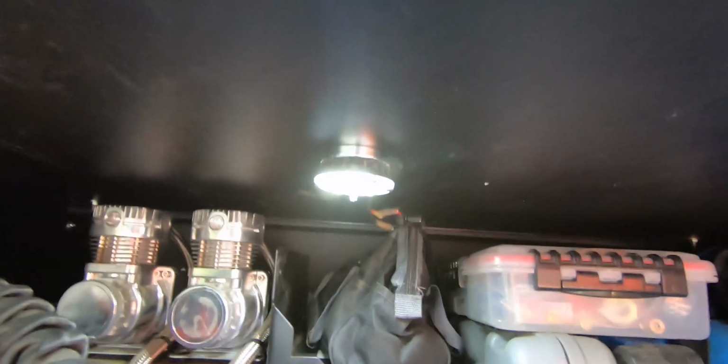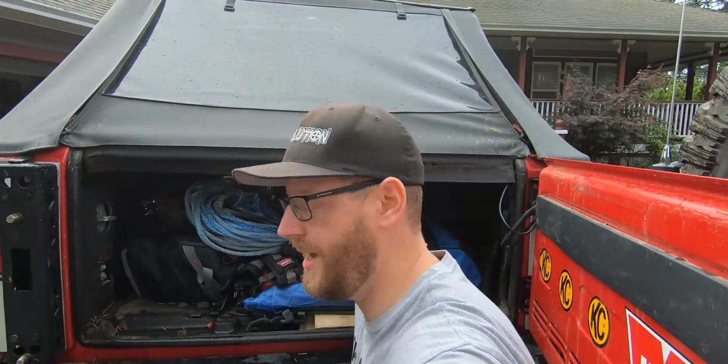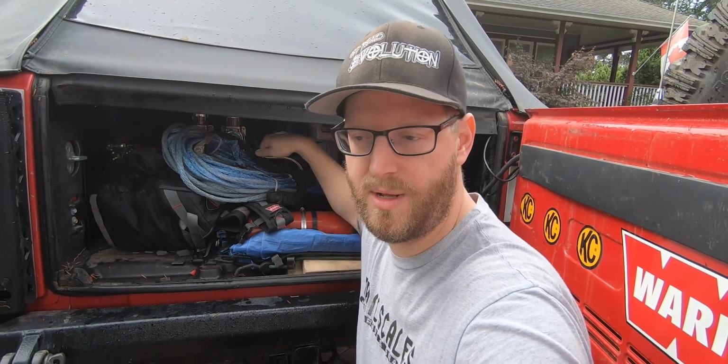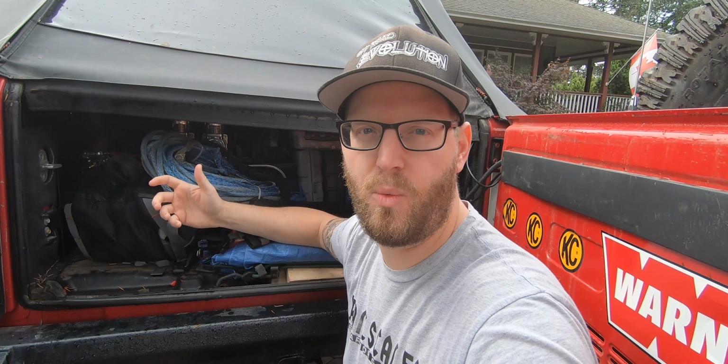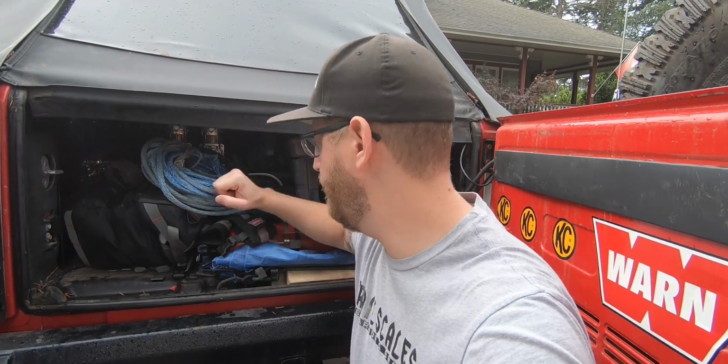Now what happened is this light wire runs down back behind my subwoofer and my gear, and the wire runs under the security deck back panel, because this has got four sides to it, and it runs down and underneath it. Now I had loomed the wire up to prevent it from chafing, but I guess something happened. The loom got pulled up a little bit too far, the wire chafed, the positive basically became exposed and hit the security deck and blew the fuse. This is why we have fuses, in case you ever have a short.